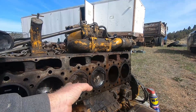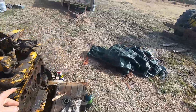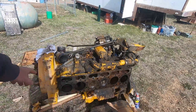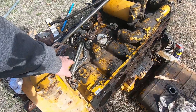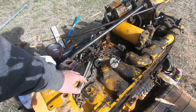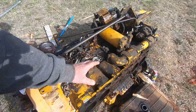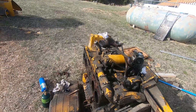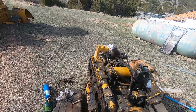Jon Jon's working on the head on this thing — that was in pretty messed up shape too. Hopefully we can get this thing working. The first task at hand is we're going to have to pull these pistons out, and they're locked in there pretty tight. This piston here I was able to get out with some fire — I used my acetylene torch and heated it up pretty good. Of course I didn't leave it on the piston too long; you'd burn a hole right through it in a flash. I got it hot, got everything smoking, and was able to drive this piston out. It looks like I'm going to be able to save it. If we have that kind of luck with the other five, that's fantastic, because I don't want to have to buy more parts than I have to. If we can just clean those up, re-ring them, hone the cylinders, I'm going to be thrilled. All right, let's get started.